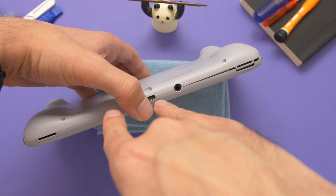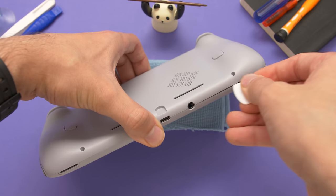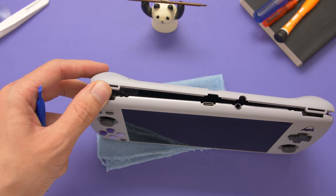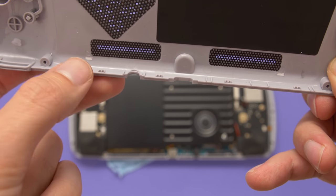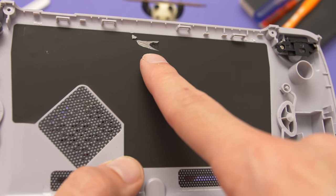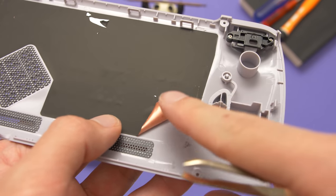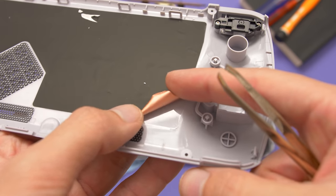Our first two clips are near the SD card, so we need to gently get the pick into place. The next clip is near the volume button, and the final one is near the power button. After this, the clips on the side are easy to deal with — there is a clip here and another one here, with two in the middle. Just get some leverage on the corner near the speaker and the first one should come free. You get both ends free, then work your way over to the other side to protect your shell from any damage. On the inside of the back shell, there is a tiny sheet of foil used to aid in heat transfer and heat dissipation — it is a very thin sheet of copper foil that helps to normalize the heat on the back shell.